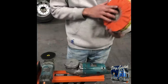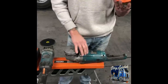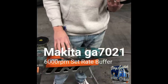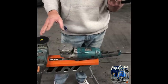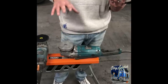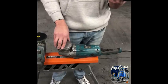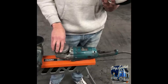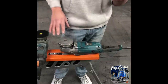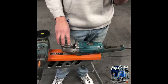For your advanced users — guys that want to get to the high mirror finish — we use the Makita GA7021. It's a 6,000 RPM set-rate buffer; it spins at 6,000 RPM all the time. Let me be the first to tell you, it's dangerous. It's very dangerous to run at 6,000 RPM. I've seen buffs blow out and hurt people — broken fingers, cuts, bruises. We run about 2,000 to 3,000 buffs a year through my shop and I haven't had any of these buffs blow out.